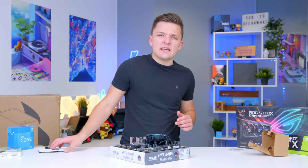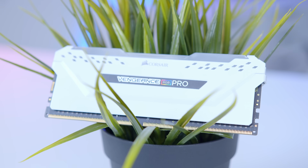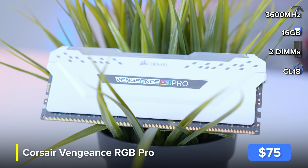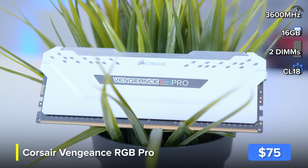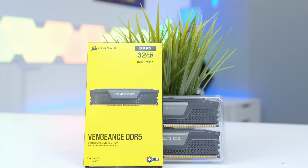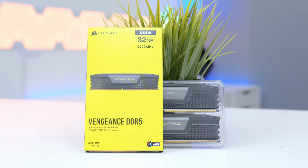Now, these new Intel CPUs support either DDR5 or DDR4 memory. I'm not exactly sure how many B660 boards will favour DDR4 over DDR5, but you should definitely pick those. There's no point buying stupidly expensive memory for an i5-12400. DDR5 is great tech, and I'm glad Intel supported it on the new architecture, but it's just not ready yet for the more budget-oriented gamer.